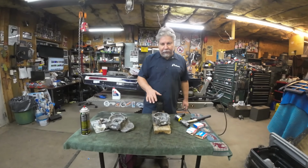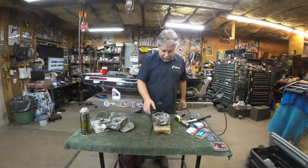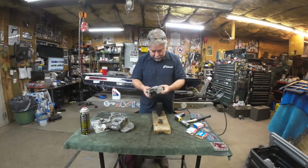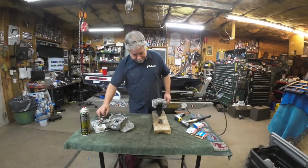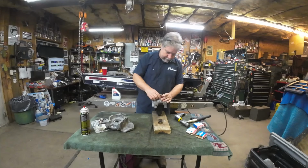That first bearing just took a little bit, like you saw, but it went right in. Second bearing dropped in. This one dropped in. And thus, I'm slightly paranoid about driving the seal in. So, I'm going to set it up on this tool, which is also what I used in the press, so that I don't knock my bearings out while I knock my seal in.